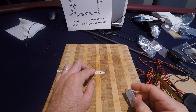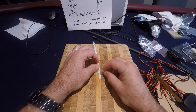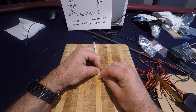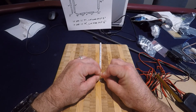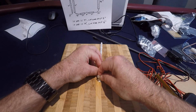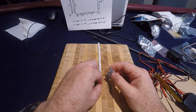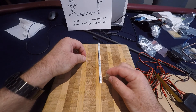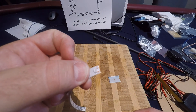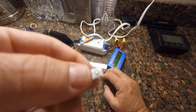Once we've got all the LED strips cut, the next part — I used waterproof LED which I recommend — is to strip off the clear plastic covering on the LEDs so you can actually solder your wires to these two contact pads. The easiest way to do it — there are good videos on YouTube — is to use a very sharp razor blade. Once you've used it for a little bit you might want to swap it out with a new one, then you just push down hard and scrape. This little piece of plastic scrapes off pretty clean with a new razor blade. Then you just scrape until you can see these pads. You can see the scratch marks from the razor blade — that's how you know you've got all the plastic off. I've got all my strips cut and the plastic stripped off.